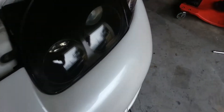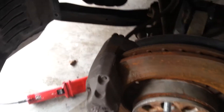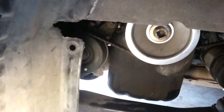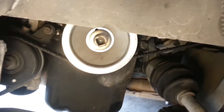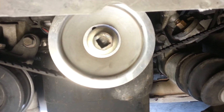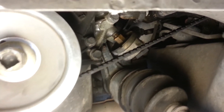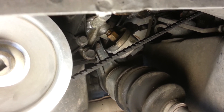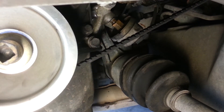I've already taken the front wheel off the car and the shroud's been taken off. To my surprise, after taking off the dust cover and seeing the two bolt holes in the frame, I found a 3SX aluminum pulley on this car — so someone has been here before. If you look on the top right-hand side of the frame, there's the oil sending unit. We're going to unscrew that, and where that adapter is we're going to screw in the new adapter.